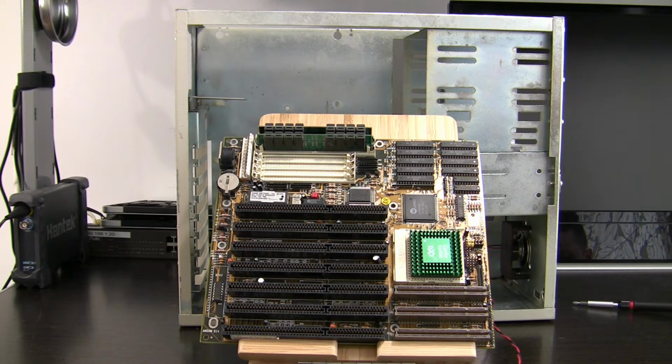Following now, guys, some caveman logic, so hold to your seats. As I told you, we are not mounting the front panel yet because we need to first mount the power switch. And we are not mounting the power switch yet because we need to connect it properly to the power supply. But no, we are not going to mount the power supply either because we want to mount the motherboard first. Less cables and stuff inside, easier to negotiate your way through the case.